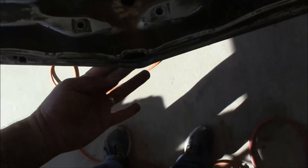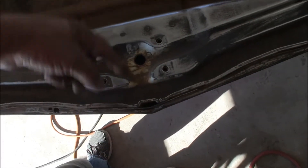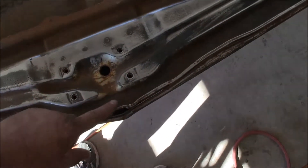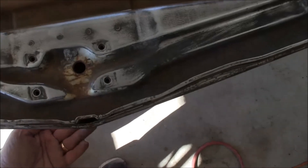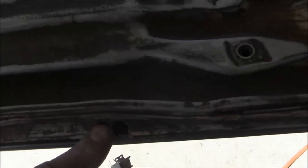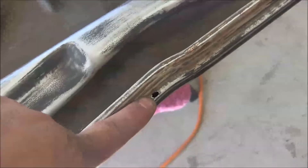I did notice one thing right here — I'm guessing there's probably some surface rust on the inside of the hood that has made that metal so thin that when I sanded it, it actually started popping through a little bit. I've got a spot to fix here, I got to patch this up. Then I've got another smaller one right down here that I got to patch up.